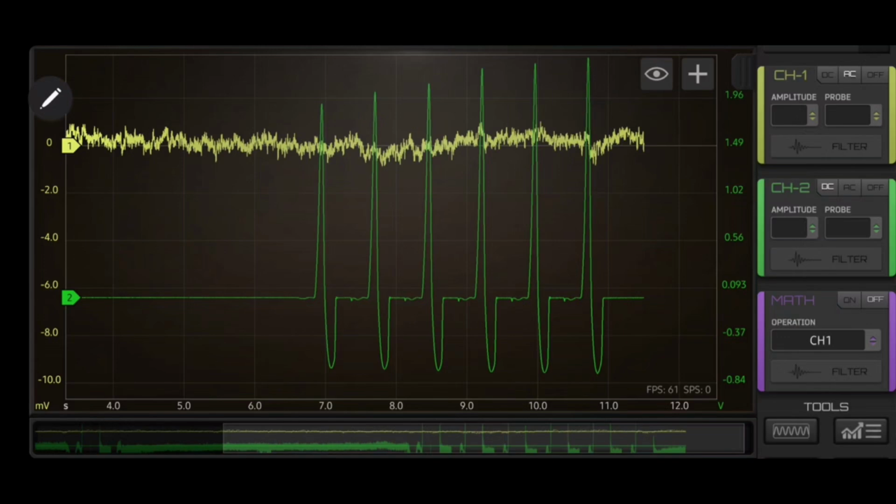So we threw the scope in it, in cylinder pressure test. Now it was only cranking. I did make sure the throttle plate was shut. And this yellow line up here is actually my first look sensor on the intake. Throttle plate shut and everything. We cranked the engine over with the starter. Obviously, it isn't running. If you guys look, we have no intake pull. And in my pulse sensor right here, I have no noticeable pulls for this cylinder. Every time the cylinder comes around, I have no pulls.